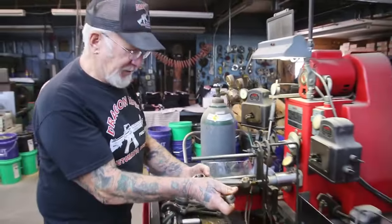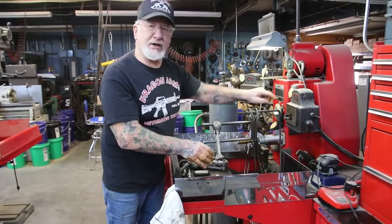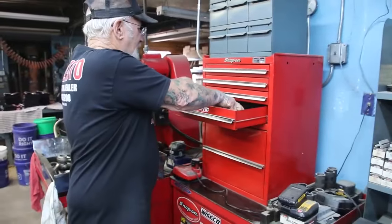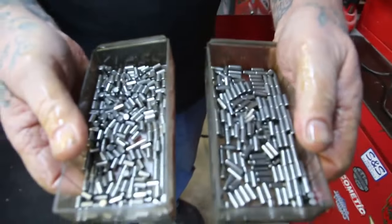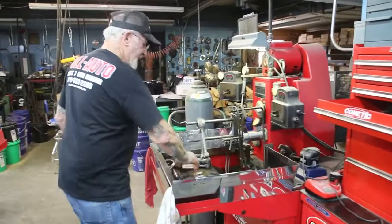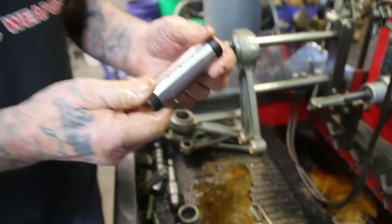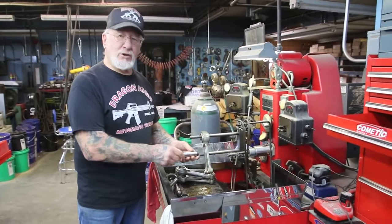I always like to rebuild the original Harley-Davidson connecting rod when I rebuild the motor. We don't use any Japanese or Chinese connecting rods. What I do use is 54 Torrington roller bearings — the small ones and the big ones, all American made. They come from Torrington in New Jersey. We use either a Jim's Machining three-hole crank pin or Easton Motorcycle Parts in South Carolina. All good parts.